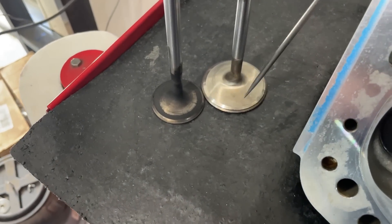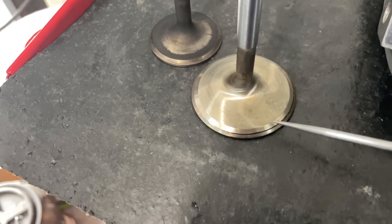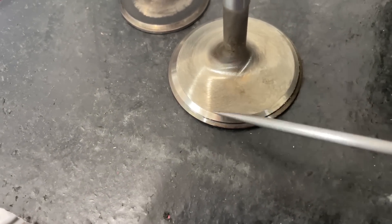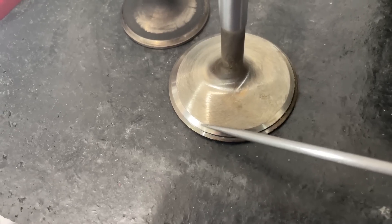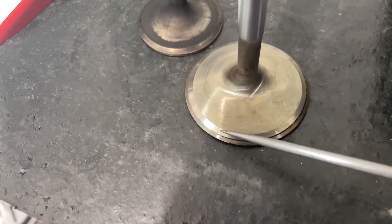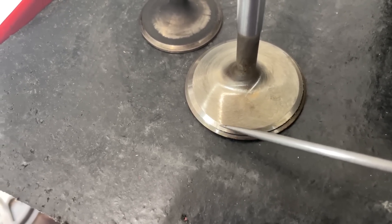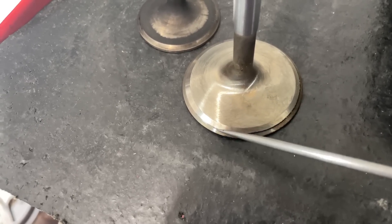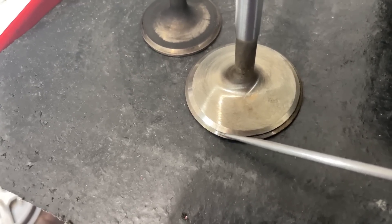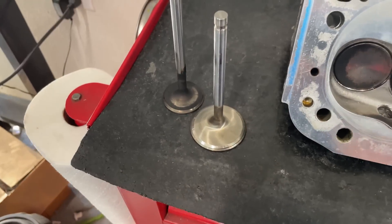It's a little bigger, and talking to Pro Max at the PRI show, they actually put their own valve job in, so chances are it gets larger when they do that. Here are the valves that came out — this is the intake valve. The back cut is actually really wide, so this thing should flow really well at lower lifts because of that. Typically a larger back cut helps out low-lift flow and might hurt peak flow just a little, but in the end you make more power.